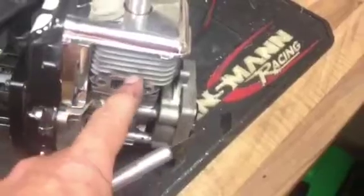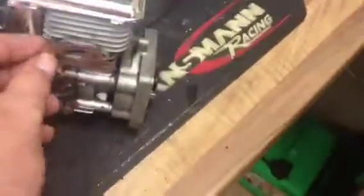Okay, so I've got the ESP engine here. It was leaking around the gasket for the pipe, so I've cleaned all that up on there. Used a scalpel just to clean off all the rotten gunk around there, so I get a nice flush finish. And I've got a nice clean new DDM copper gasket, which was sitting there nicely. I'll bolt this back on.